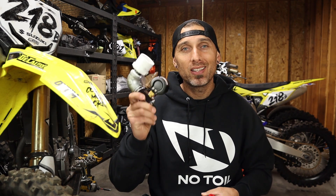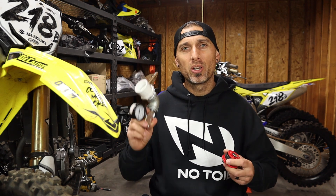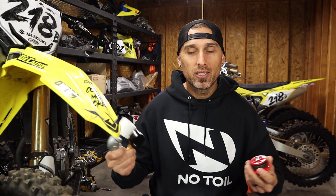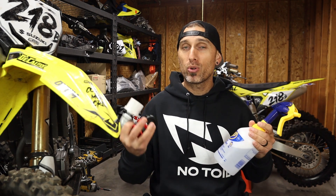I've got this homemade leak down tester. You can make them many different ways and I'll explain why I made it in this configuration very shortly. Long story short, we're gonna plug up the engine with an exhaust plug — all the parts list will be in the description below. We're gonna plug a few more things on the engine, then pressurize it with this leak down tester. We're gonna pressurize it with about 5 psi using a bicycle pump, and then spray everything down with some soapy water to see if we can find air coming out.